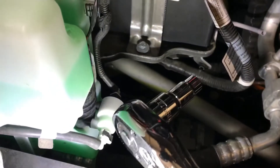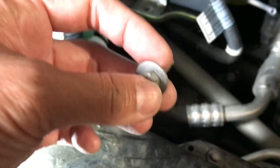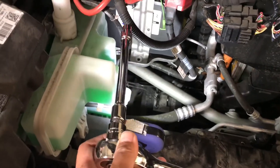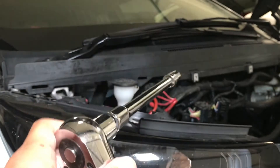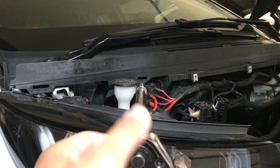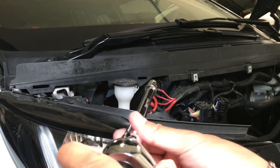I'm just going to use this 10mm socket wrench to loosen this guy right here. This one you will need to remove completely. The top one behind that green cable will require an extension on the socket wrench just to be able to reach back there. Once you loosen the nut, rather than using the ratchet itself, I just turn it by hand — it's just a lot quicker.